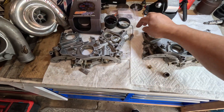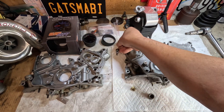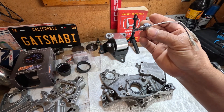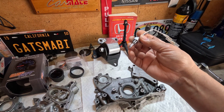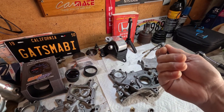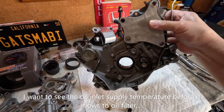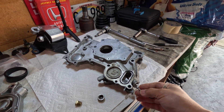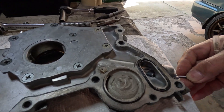Today's episode is all about the installation of the sensor for the temperature gauge. I thought about multiple places where I can add this. I thought about installing it right at the oil pan by the drain port area, but since the oil pan is being cooled by the running air or incoming air, I'm just going to put it here right by the oil pump, and it will have plenty of oil passing through right there.